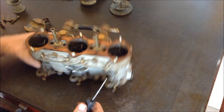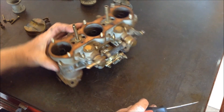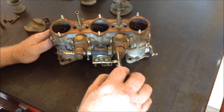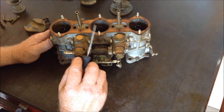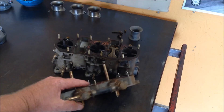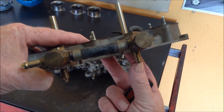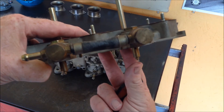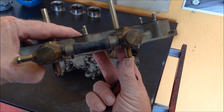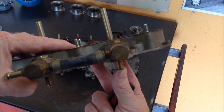The third and main circuit in the carburetor is within the carburetor, and now I'll try to explain how this works. Of course you have the gas coming in from the fuel pump — it goes in, there are little screens in here. Under this little brass guy is the needle seat. Here's the top of the carburetor and here are the needle seats. It's a spring-loaded arrangement. This drops down into where the little tab on the float comes up, then it depresses it shut and stops the flow of fuel, keeping the gas uniform in the float chamber at the right height.